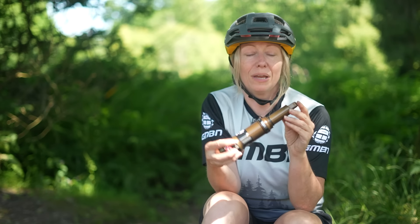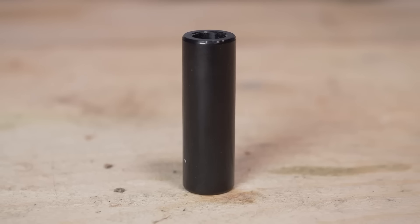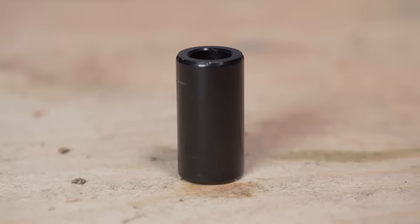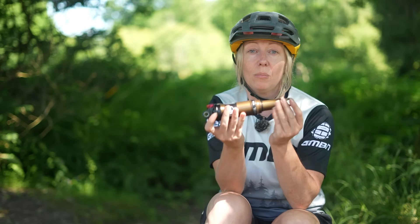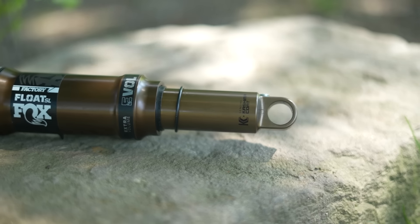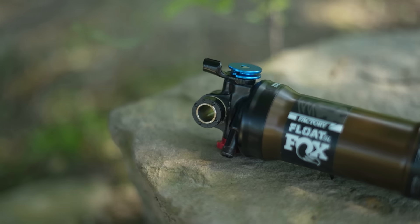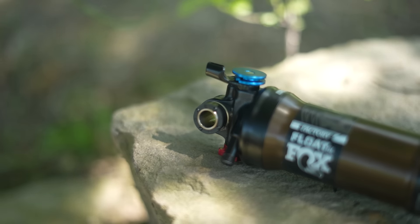When you buy your new shock, it won't come with any mounting hardware — that's the hardware required to mount the shock to your frame. Some frames require it, some don't. For example, on mine here, I don't need any bushings in the lower part, but I do require a bushing in the top to be mounted to the shock so that it goes into the frame. Usually your manual or technical specs will tell you what bushings or mounting hardware you require.